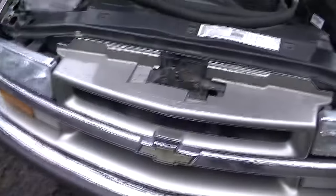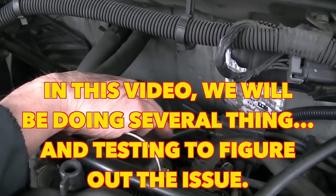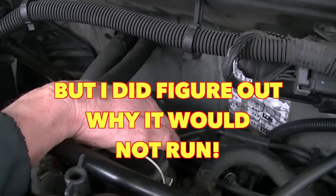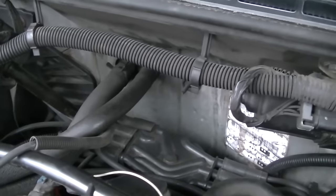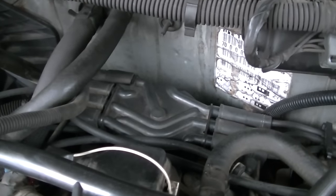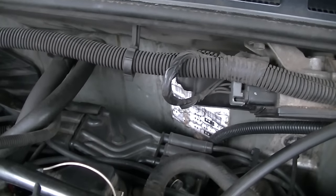It's been a little wet today and this problem happens a lot, especially with a little bit of moisture. The temperature is in the 40s and it's been damp. On cold damp mornings, what we've got to do is take this distributor off. The distributor is pretty much worn out, and when that rotor spins, a slight amount of moisture - condensation - gets inside. You sometimes can't even see it. When the rotor spins it jumps fire between the spark plugs and causes the engine to backfire and jump like you heard. We need to take off the distributor cap, dry it out, clean it up with some starting fluid, and see if it'll start.